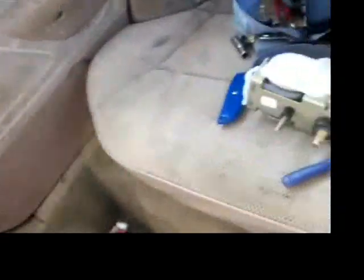The way I had to remove this, in the back of the other car, I'm not going to show you how to do it, but you take this clip off here, and then you got to take the lower part of the seat off, which I'm sure you know there's a clip here and on the other side, and it pops up and comes out, and there's a bolt down here and a bolt there, and then back inside the plastic down in here, you take the seat belt or the speaker cover off, pop the panel off, and get all the good stuff in there.